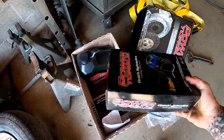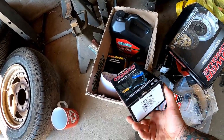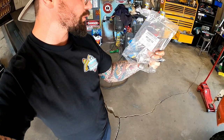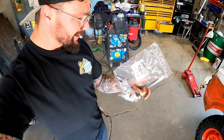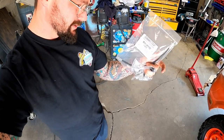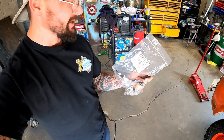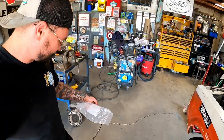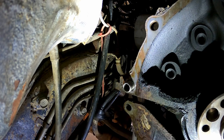Hey-o, there we go. Just playing, that's for up top. There we go, bet that's her. Looks close enough to me. Last time I tried to order a rubber hose for the clutch specifically, they couldn't get them, but the ones for your brakes, they're only a little longer, it'll work the same, and if you can't get them, well, that's because I bought them all, like I just said. Rubber hose ain't in the worst shape, but might as well since we're here.